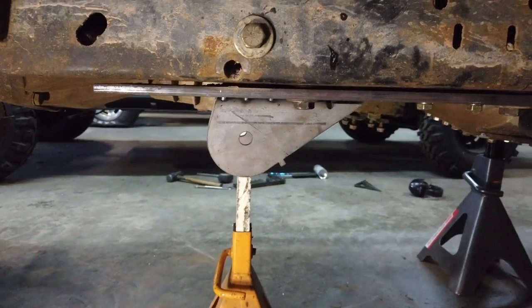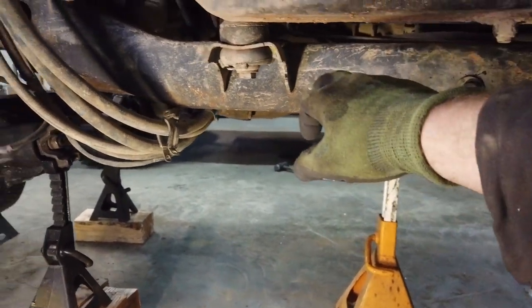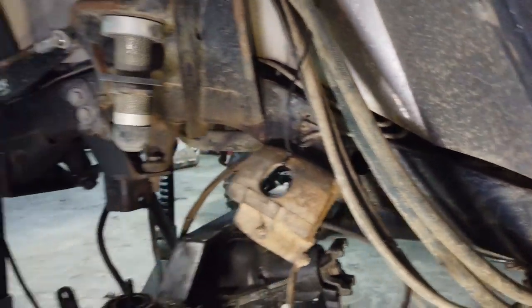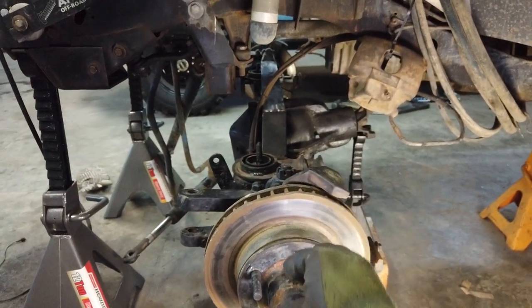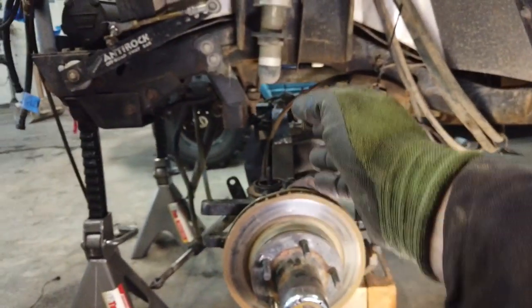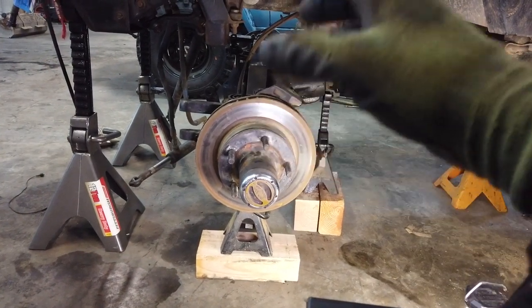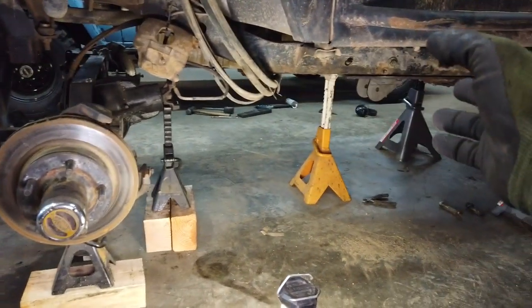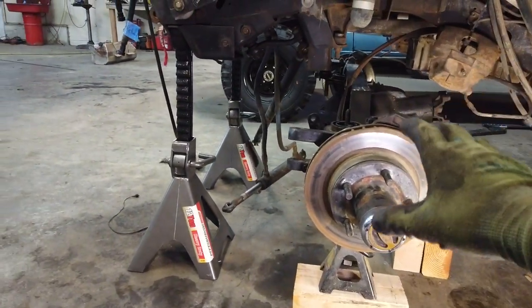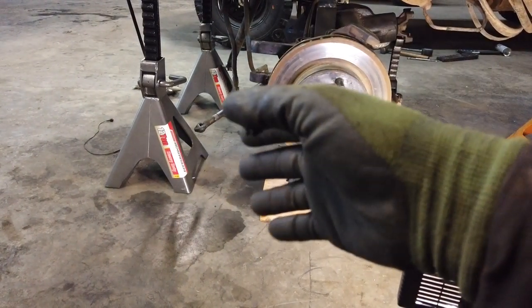I got the upper mount right on top of the lower mount, which is what I was going for. If you moved the upper forward to about 70 percent of the lower arm length — a very common setup — it keeps your ball joints in the same orientation as ride height as the axle moves up and down. The way I have it set up, as the axle droops it actually twists the axle forward, keeping the pinion pointed at the transfer case output shaft. The disadvantage is that when fully flexed and steering, I'll be steering slightly on the front of the tire instead of the center.